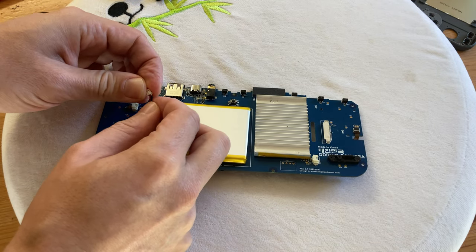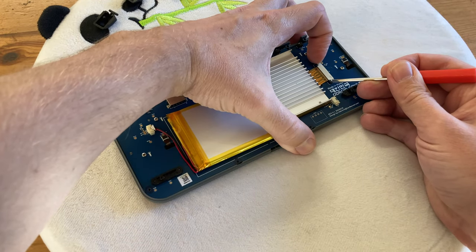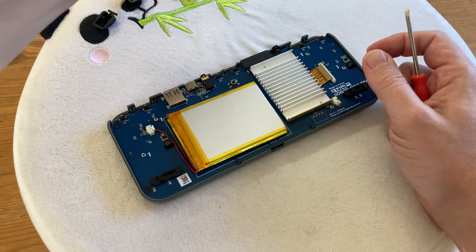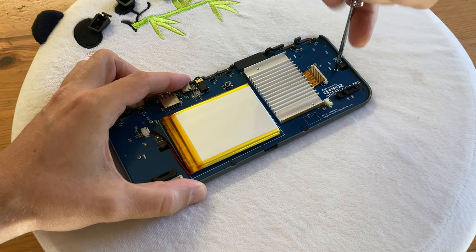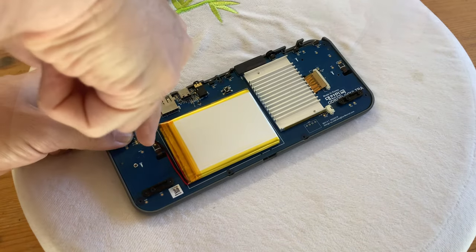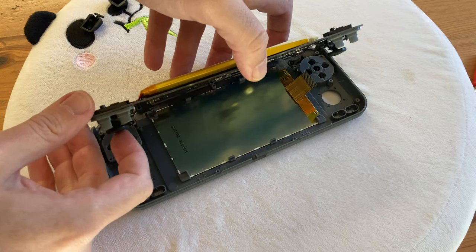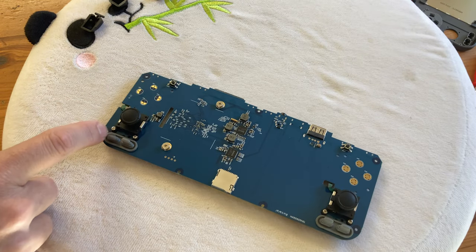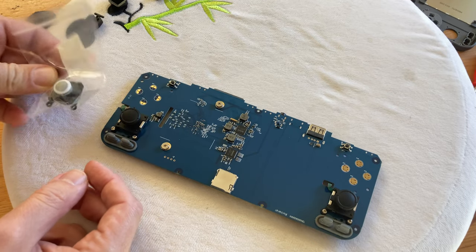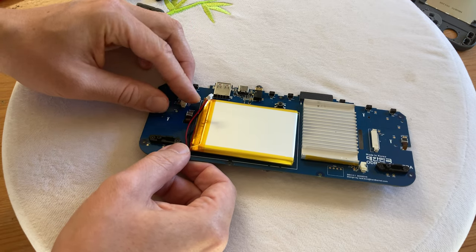If you see a bit of wire showing, you can just push it back in. To disconnect the screen, we'll need to pull on these stems — be careful. We'll need to take out four screws on this main board, and then we can just open it up. First thing we'll do is change this analog stick, and it's pretty surprising to see that the Vita stick is actually really small. On the other side, we'll pull out the tab and remove the ribbon cables for each stick.